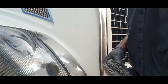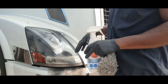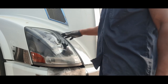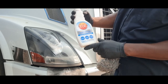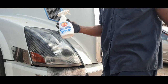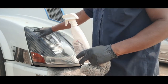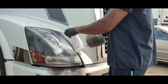The next step is completely optional, but it will make what you just did last longer and prevent the lens from fading and yellowing again as fast. Get yourself some 303 Protectant — you can find it at AutoZone, Advance Auto, or order it online on Amazon. This will protect the lens so it won't fade as quickly again.